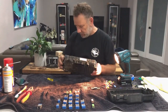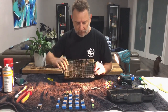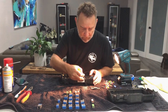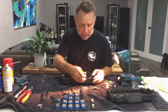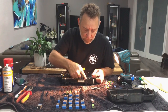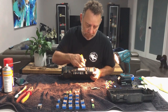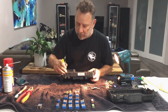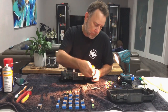The next step is to pull this apart. If we turn it over completely, there are these little tabs here that need to be pulled out to allow the case to spread enough to pull this base out. Basically, you'll see these little sections where you just need to put a screwdriver in and just spread it. Then you can twist upwards and release that tab. I've gone around and done that already all the way through and slowly you can just work that up all the way around.